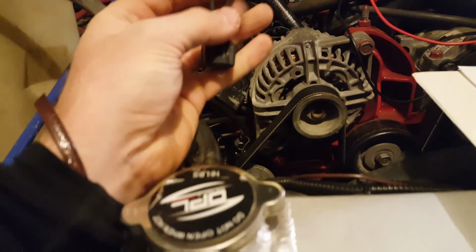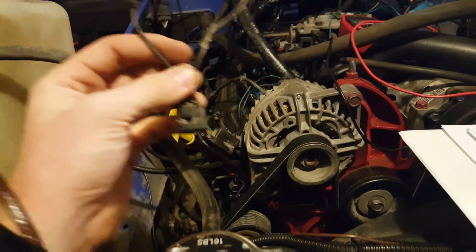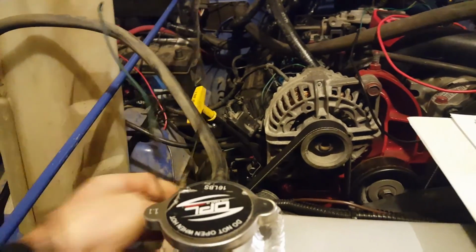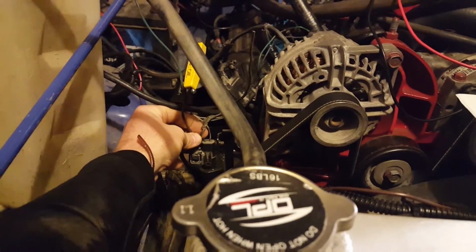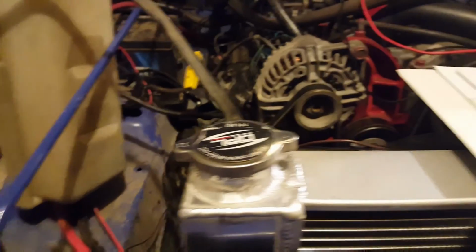Now as far as the coil goes, it looks like the coil is wired up exactly the way it should be. The gray wire is the driver and it's in slot number 2. It's exactly the same on here, the connector for the Dodge. The black and gray one on my pointer finger here is the driver and it's on number 2. So this is the way that would plug in. Last resort would be to switch those 2 wires and just see, maybe for some reason they're off. Because let me show you this.